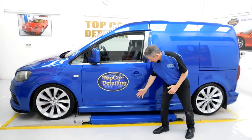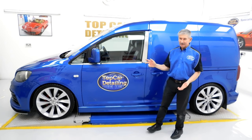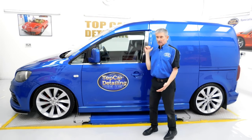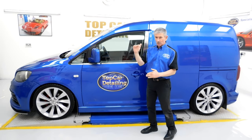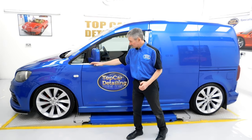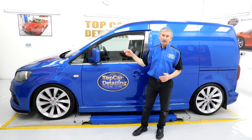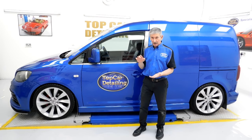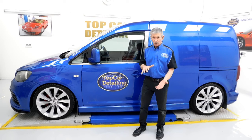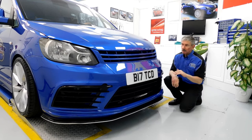With the side skirts fitted, it gives us more clearance underneath the van as well. On the Caddies you can drop it quite a bit with suspension — we've got leaf springs on the back and we're on hole number three at the minute on the drop-down brackets, but we can lower it more if we wish. On the front we've got adjustable coilovers, but at the moment it's set at the right height because we have a front splitter on the bumper and it is quite low to the floor near speed bumps — we don't want to cause any damage.